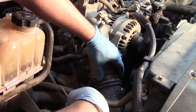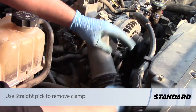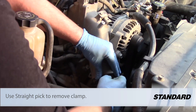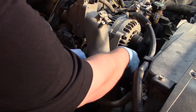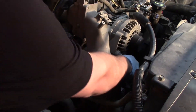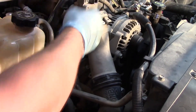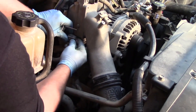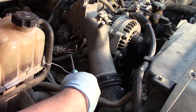When you get to the air horn itself you're gonna find a clip — that's not gonna be a clip you take off with a screwdriver. The best way to do that is just get a nice pick, get right in between that groove, lift up, and that clip will come right off, not a problem. Now that we can actually see the EGR valve itself, we're gonna go ahead and disconnect that before we go any further — so now we've got that disconnected.